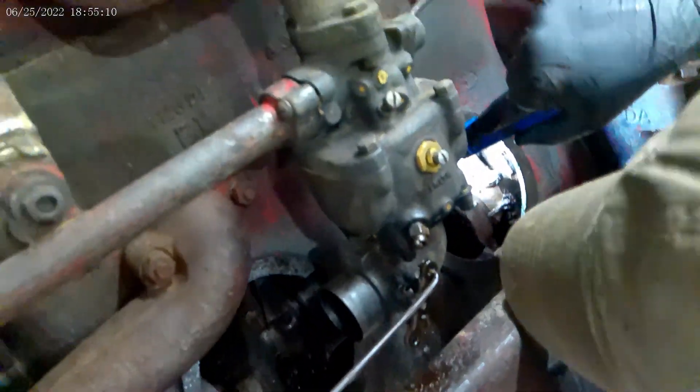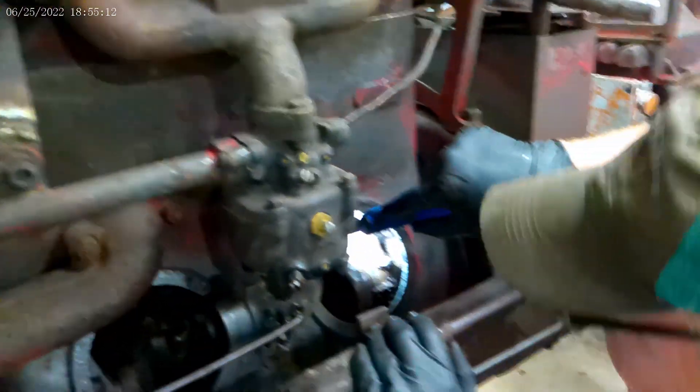Back there's the end of the cam, and then that vertical piece is the oil pump back in there, and it's all rusted and stuck. And back here, this back main bearing — it's pretty darn ugly.